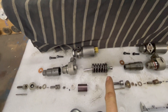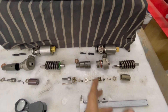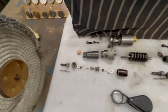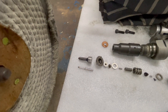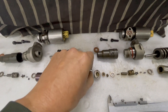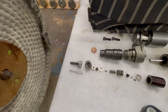I want to see if the lift is actually different or very close, because if it's close that means you could interchange nozzles between each injector. I'm after some larger nozzles and doing research to find ones that will match without having to get the expensive re-honed ones. I want to get genuine Delphi ones rather than Firad ones.